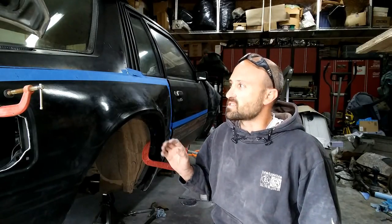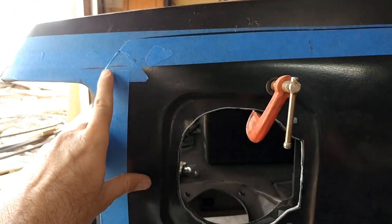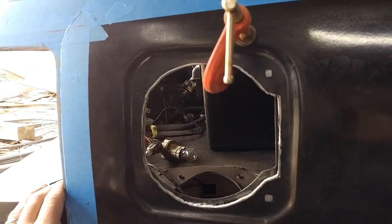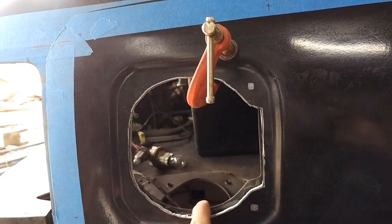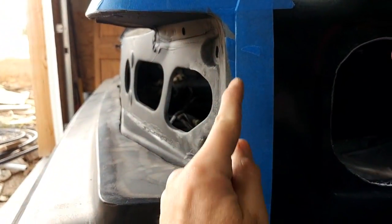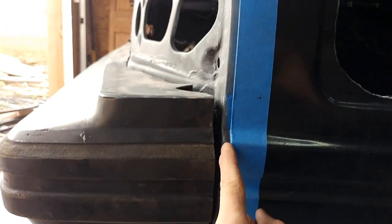This is the scary part to me because once you start drilling holes in the outside body there's no going back. You could resell this stuff and somebody would probably pick it up for what you paid, but putting body holes in the body - I'm getting nervous on it. So I'm going to double check my measurements and then let me show you these marks so you can see what I've got if you want to do it yourself. I'll show you front and rear - here's both of the marks. This is the flare, here's the corner of it, and this is the body. You can see those match up. Looking at the fender well itself or the fuel filler - that's almost dead center of where it should be, and then I've got my mounting marks there. On the back side you've got it roughly about a half inch but it matches pretty well going down.